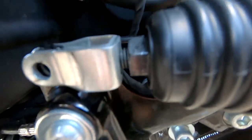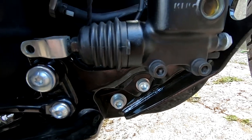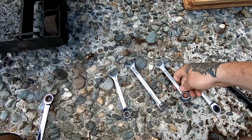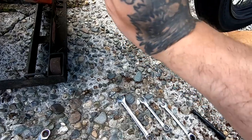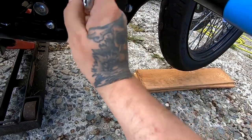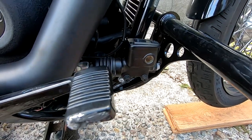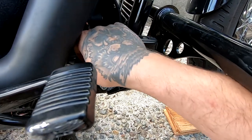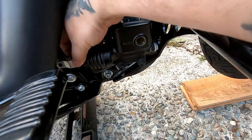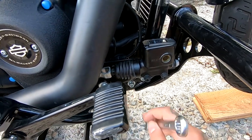That's probably about an eighth to a quarter inch of adjustment. Then just use your box wrench to tighten it back up. I grabbed a bunch of box wrenches so I didn't have to run back and forth — I think it was the 14mm. It's a very simple fix. I checked YouTube and there's not many videos on this, but I saw a lot of people complaining on forums, and I just don't see why people take their bikes into dealerships when issues like this are so easily fixed yourself.